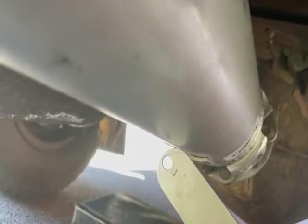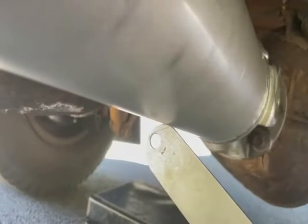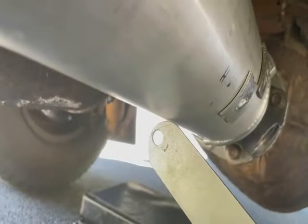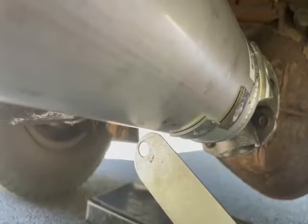As I rotate the tire with my foot — it's important not to grab the drive shaft — you can hear it drags at one point. There's a high point I have marked, and as it comes back around there's a low point, then a gap. At the high point it kisses the indicator and moves further away.